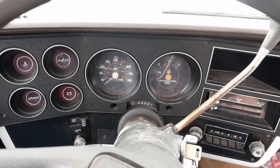This is a very complicated system. It's the most complicated part of the carburetor, in my opinion. This thing would make Rube Goldberg proud. So this model has an electric thermostatic choke. I'll try to explain to you guys how this works. Behind this plastic cover, there's a bimetallic clock spring. And when it's cold, which it is now, it's trying to pull these levers back up to the top.